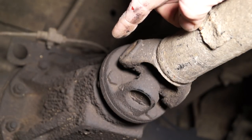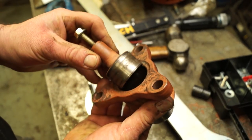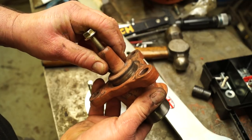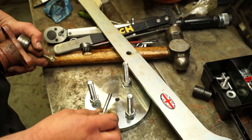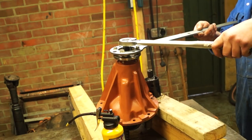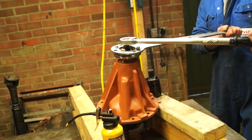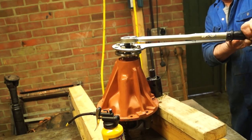The flange here — you can see this is a later type of flange. I've explained in the 4B puller tool video how to remove this because it can be awkward, and I'm not going to repeat it here as the video is already up on YouTube — the link is below. Neil's made some really good tools and they are worth their weight in gold. Remember, you can always buy them and sell them again on eBay or hand them to a mate. You really do need a prop shaft or flange holding tool when changing seals and torquing the nut back up again. You can do it without it, but it's awkward.